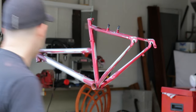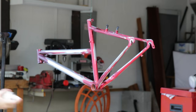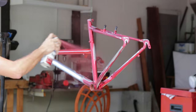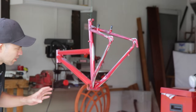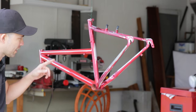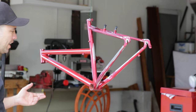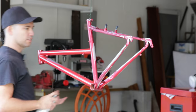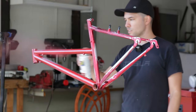Most of it is going on super glossy and nice, but I'm seeing some weird things I don't like on some of these rust spots that I thought I got completely. I did also go over the whole thing with alcohol first - I cleaned it with water real good, then went over it with some rubbing alcohol. So I was hoping everything is clean and nice. I'm a little bit concerned about those spots I just saw, but let's keep going.